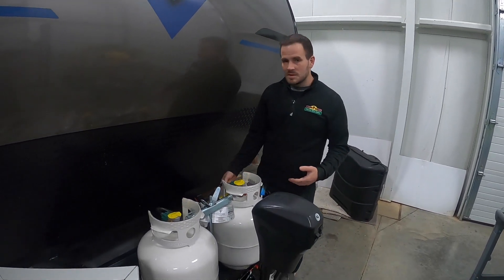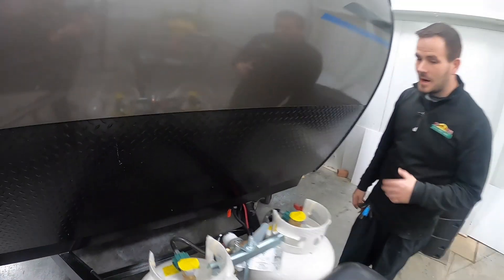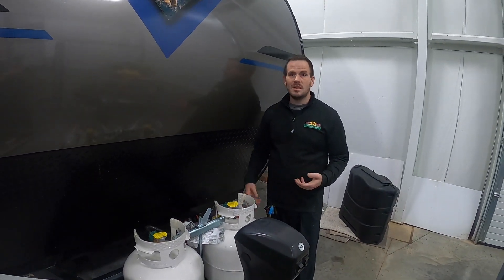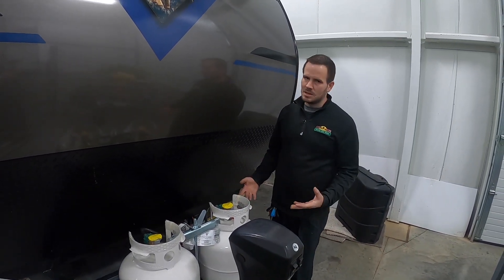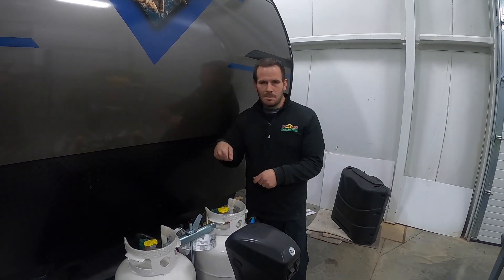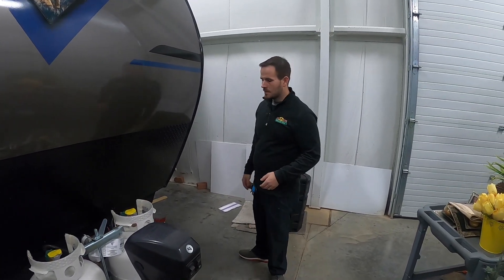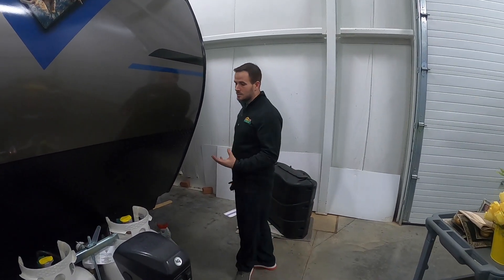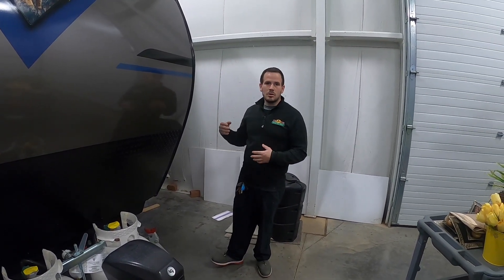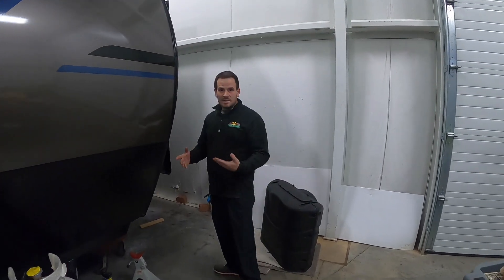Behind that, you'll have one 12-volt deep cycle marine battery after purchase. That battery is not maintenance-free, so it does use distilled water. You want to check it every six months, at least once a year — I recommend doing it more. You have two caps on top; pop those off and check the water level. If it is low, fill it with distilled water. If you don't do that, you can over-boil the batteries, causing loss of charge. That's something you always want to check on when doing maintenance on the RV.